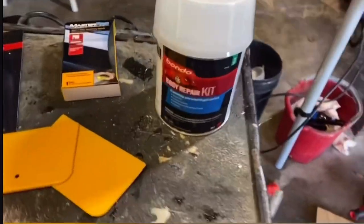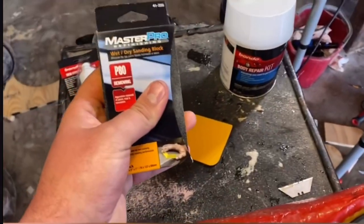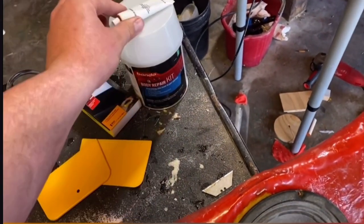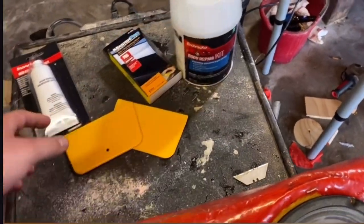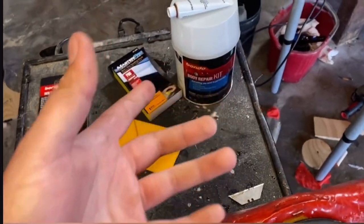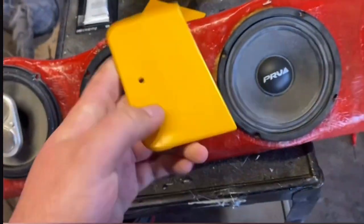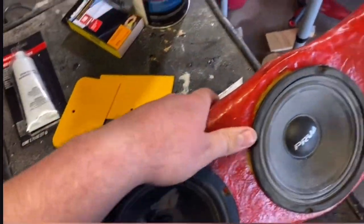So what are we doing next? We're going to be doing some Bondo — got it from O'Reilly's, along with some 80-grit sanding block. This is the hardener that it comes with. You mix a little bit — add a couple drops and that's what makes it harden up. I bought some extra hardener, you always need some extra. I like to put a little bit more just to do the job faster so it can dry in a couple minutes. And then this spreader is to spread it out.